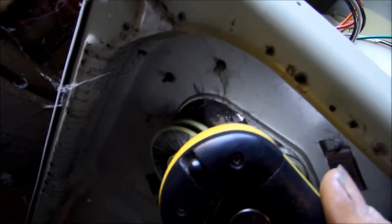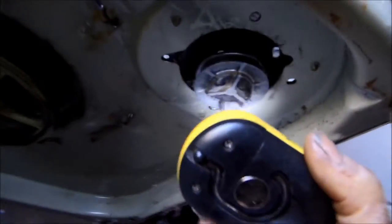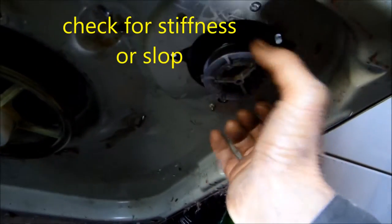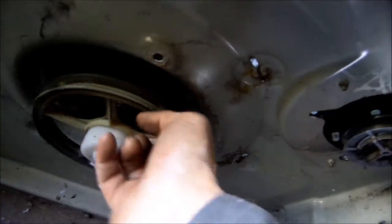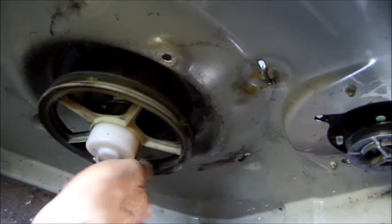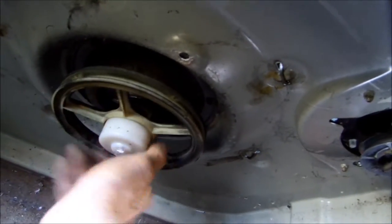Here's your motor. There is your bottom bushing right there, and here's your water pump. Here's your main pulley. This water pump — if your water pump is stiff, then you need to replace that. But this one seems to be good. This doesn't seem to be any problem; it seems to be working fine. It's not hung up or anything, so I don't think there's a transmission problem.